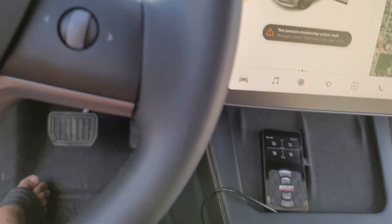The air-out always catches everybody's attention. Just a quick rundown of how the air ride's been set up — it's been great, I've had zero issues with it, everything's working as planned. I do have some different pump mounts on the way so they'll be a little quieter while running. They're loud but not obnoxiously loud when you're driving. I just want to quiet it down a little more since the car makes basically zero sound while driving.